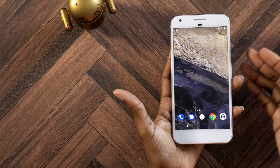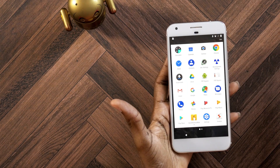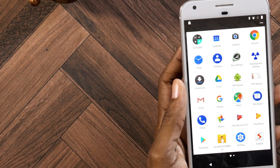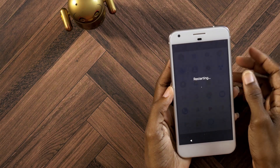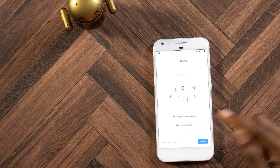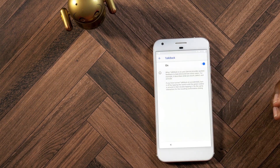Now, the first thing I'm going to do is walk you through the steps as to how I actually got to this point and show you what we're going to do next. As you can see, this is the home screen here — I'm able to go in the app and draw all these things. But if you see at the top right, the FRP lock is still on. I'm going to restart it and show you how to get to where I am now. Alright, so right here you have the home screen. The first thing I normally do is try to turn on TalkBack — also, the first thing you actually need to do is connect to the Wi-Fi and then go back to the main screen. So go to TalkBack, turn it on, click OK.